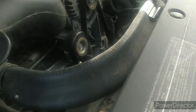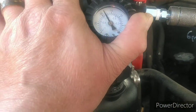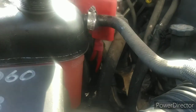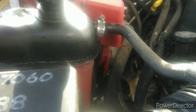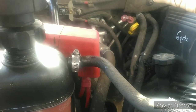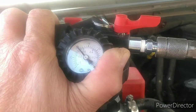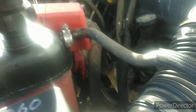We're working on how flat that hose is — Harbor Freight coolant vacuum. It's a slow process because we still have coolant in it. We did this last night and got another half gallon or so of coolant in, got the rear heaters to work, but the front heater was still not working — makes no freaking sense. We only got it down to 16 inches of mercury last night and we're almost at 20 inches now.